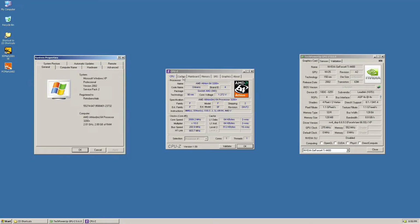This CPU was available starting with May 2006, and we have 3 years of CPU evolution, and this is the third AMD socket we are looking at. Just like the previous Athlon64s, this CPU doesn't run at 3.2 GHz. The number is just so we can compare it to other processors. Still, by 2006, Intel has moved to a more efficient architecture that achieves better results with a lower frequency and no longer uses a one-to-one match for the frequency to the performance rating. Fortunately for us, the Athlon64 still uses this number, and it directly competes with the CPUs we had so far in this series.